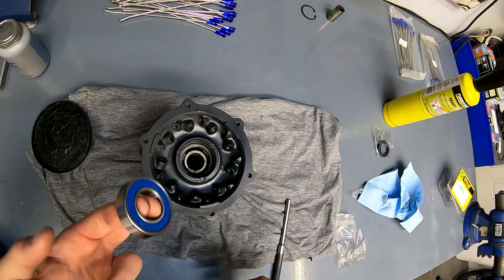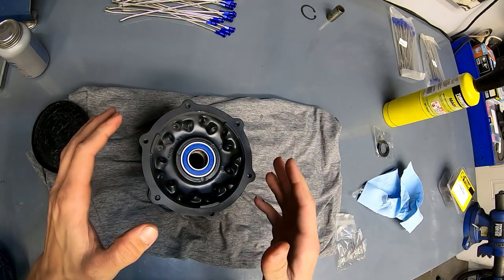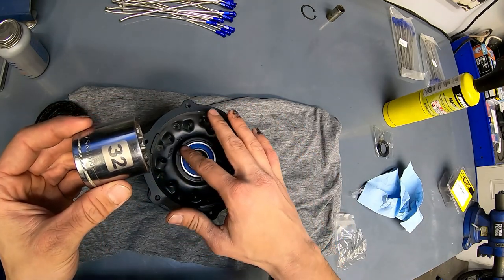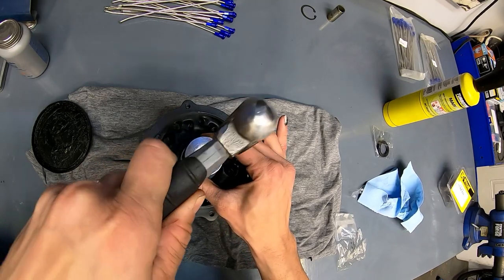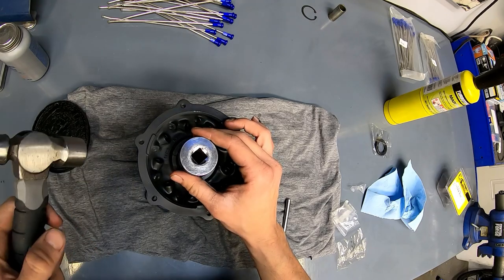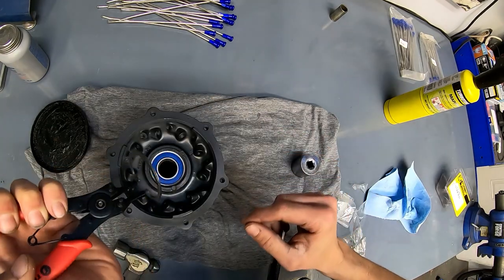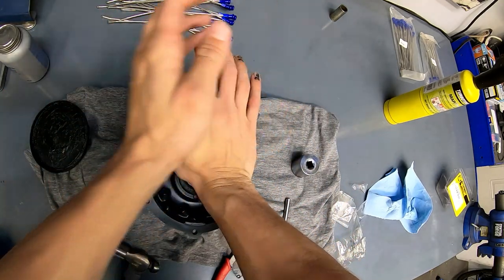Just for comparison, I'm not going to heat this side of the hub and we'll see how this bearing goes. It makes its way in, but it doesn't go all the way because that extra expansion is very helpful. So in this case I've got a 32mm socket. When you use a method like this, always use the outer race and not the inner race of the bearing. Apply nice even pressure all the way around, making sure the bearing goes in evenly. Once the bearing is seated, you will hear an audible sound difference. This rear hub uses a circlip, so I'll get that installed. Then install the last seal. Your brand new wheel bearings and seals are installed.